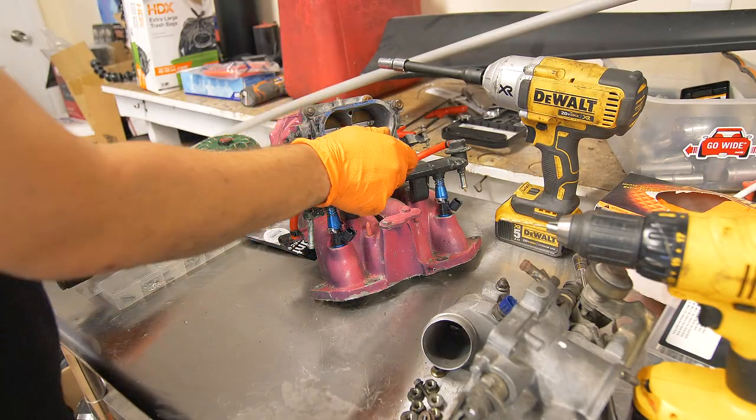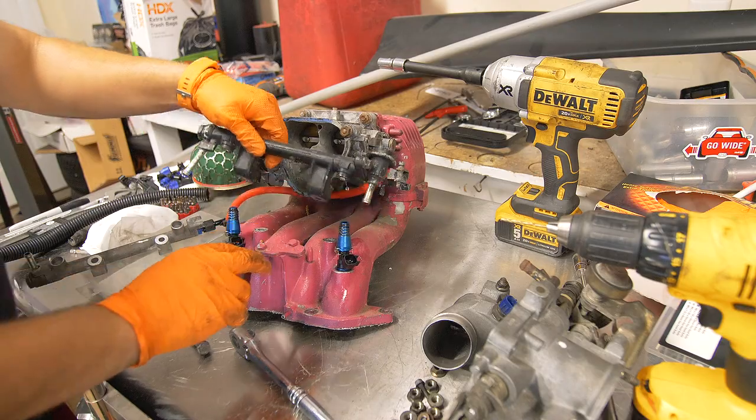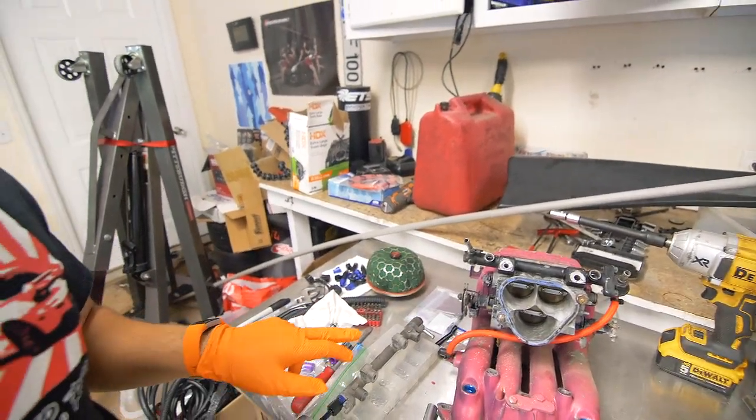Now we're going to transfer our secondary fuel injectors to our new fuel rail. All right, guys, we're going to take a timeout real quick. In the process of transferring the injectors from the S4 rail to this S5 rail I have, originally I just thought that someone added that aftermarket and fit in an FPR. But what I just discovered now is that the bore size has been increased from 11 to 14 millimeter. And it's a pretty common modification from what I understand.